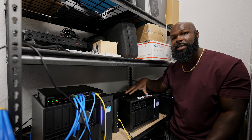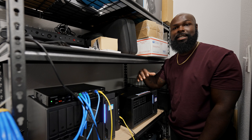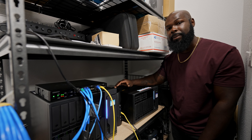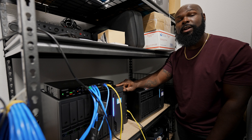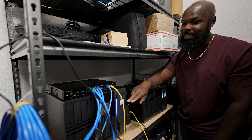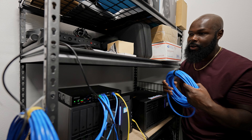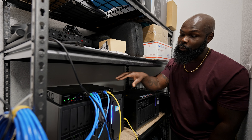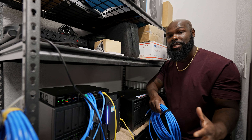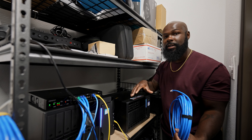One thing I want to point out is that I'm not going to link this NAS to any of the systems. It will not show up as an actual storage drive on any of the computers in the office. It's only going to be recognized once we go into the QNAP software and sync this NAS to the H1288X. We're literally just plugging one cable in from the back directly into the switch and then all the rest of the work happens at the computer.